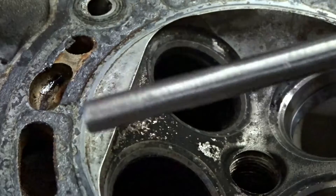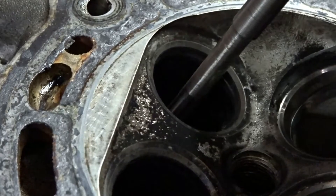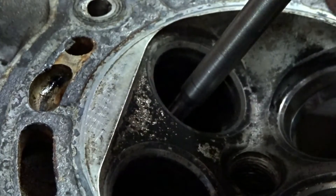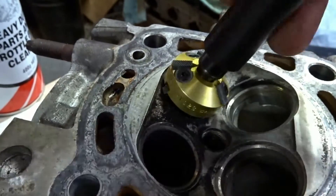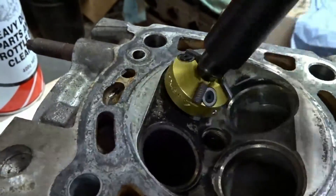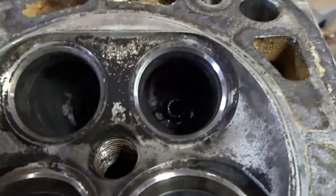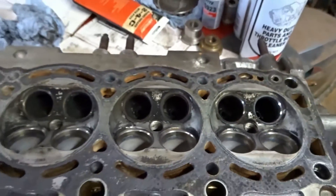And that's just the T-bar that turns the cutters. Let's get into it. You need to lubricate your guide to protect both the guide — they are a taper so you've got to slide it in there pretty much until it stops. Put your seat cutter on there, 45 degrees down. There we go, that looks pretty good — nice and concentric, we've got a nice flat surface now. 15 more to go.